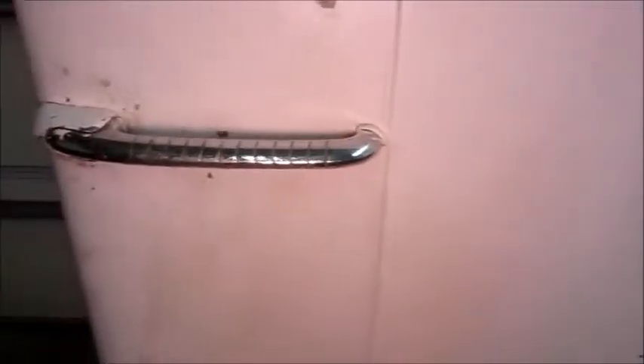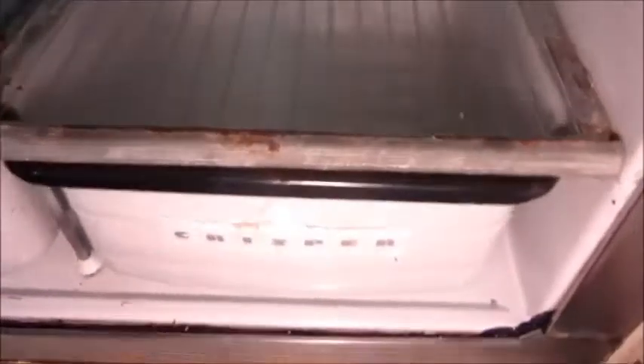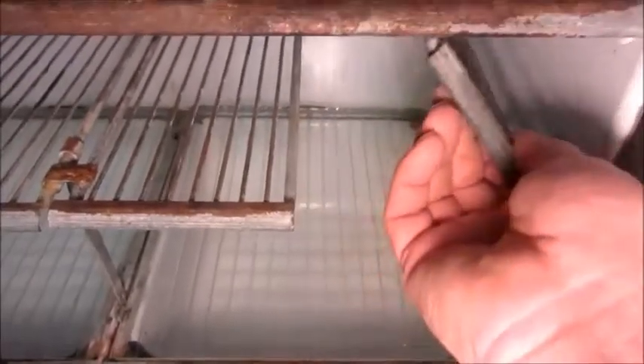We've got a repair project that appeared here in the shop while I was out of town. I've got a Kelvinator — it's got some patina on it but looks to be mostly complete. The interior has two crisper bins with ribbed glass shelves, a little flip-up shelf, a light bulb, everything. The frozen food chest needs a little bit of work. This one was the victim of an accident — this tape is over some damage in the evaporator, and that's why it's here: to fix the evaporator and rewiring.